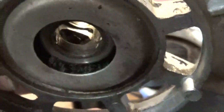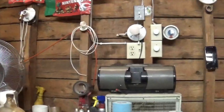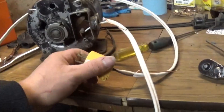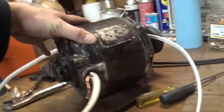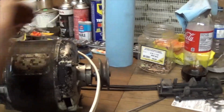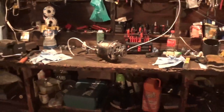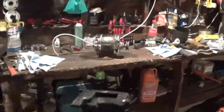Unfortunately I got way too excited with the air compressor and blasted all the wick out of the hole. There we go, she's ready to plug in. I won't be doing it in here because the breaker could possibly kick and it'd be lights out for the whole shed. I don't want to stress my house wiring, so we're going to head to the shop. I went ahead and dug that wick around and pushed it back down into the bearing - it's taking oil really well. I gave both bearings a bunch of fresh oil and she's spinning like she never used to.